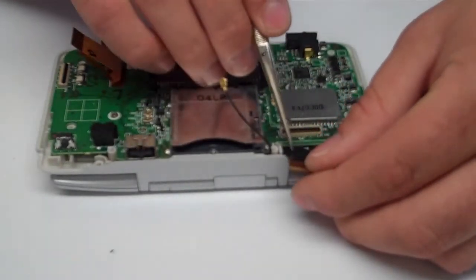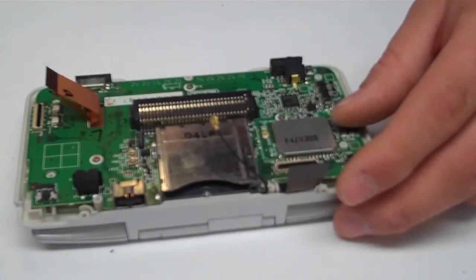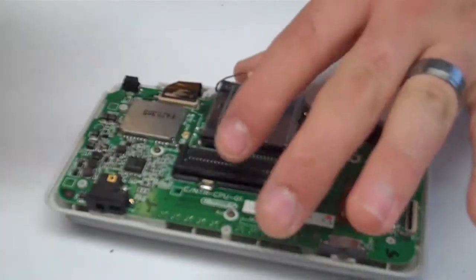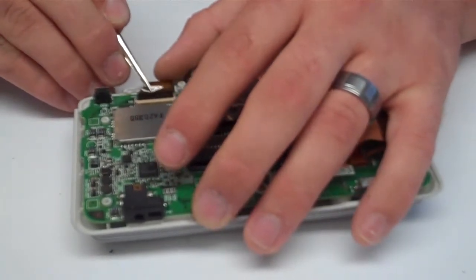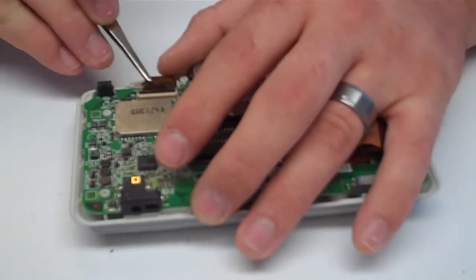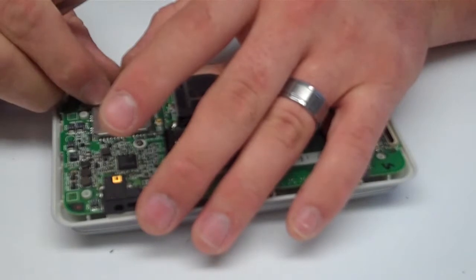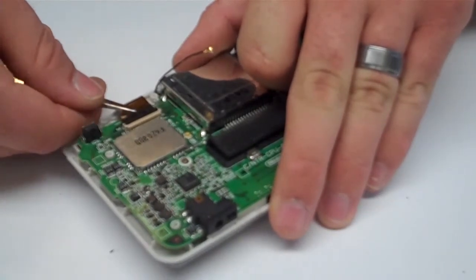So with your ribbon cable in the back folded over, it should poke out right at the upper LCD ribbon, and you go ahead and just set that into place on your ribbon cable like that. You want to take your tweezers and grip the ribbon cable on the back of it and use the tougher plastic they have on the end as kind of leverage to push the ribbon cable into its slot. And there you go, you see that it just seated.